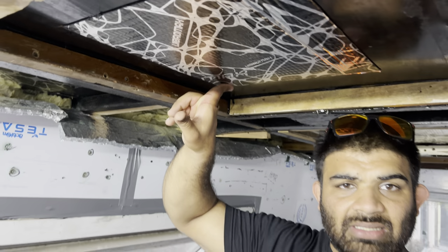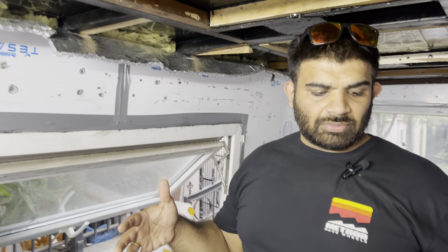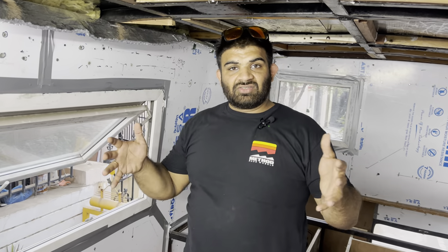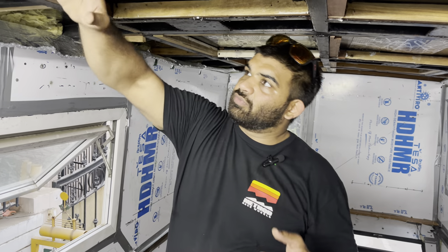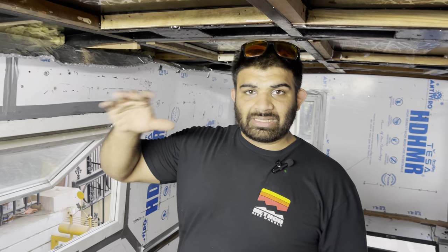This is your regular damping — 2.8mm thick damping that we see in cars; we do it for audio and we do the doors with this sort of damping. We put this on the tin metal everywhere. This avoids the flappy effect — it makes your panels feel heavy and avoids all sorts of rattles in the cabin. It does offer a little bit of insulation as well. But the main idea is to give your structure a solid feel and to add to the strength of the metal.